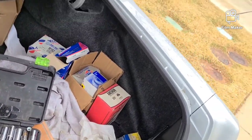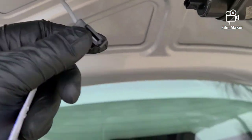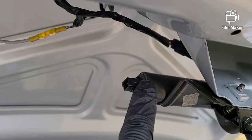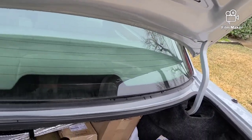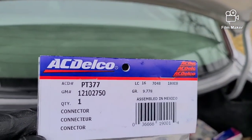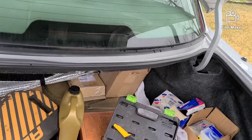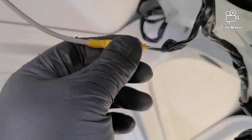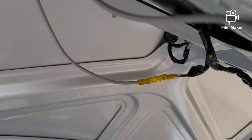I also had to put a new connector wire on here. The reason being, the connector on the updated trunk pop is different from the original one that was on the car. The part number for this connector is PT-377, or GM part number 12102750. I ended up cutting about six inches off the original wire — it had about 18 inches, so I left plenty.